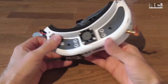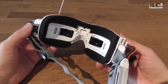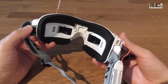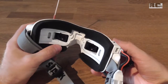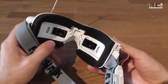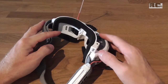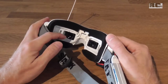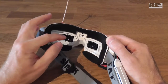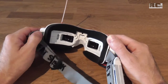I put the Dominators together again and wanted to check if there is any change in the lenses - no more disturbing points. But what I have to say is that nothing changed. The reason why nothing changed is that it wasn't dust or something on the lenses - the problem was that I had put my goggles down on the field, and the sunlight went into the lenses. If you have too long a time of direct sunlight in your lenses, the sunlight will burn tiny bright points onto your goggle displays, and the result is that you have these little bright points forever on your goggle displays.